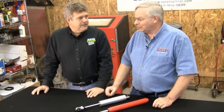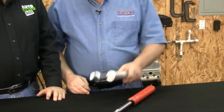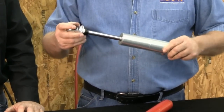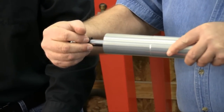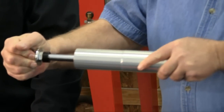Actually, so you can install it too. When you go to hook it in, you've got to be real quick when you cut that wire to catch it into the hole to get it to go in there. A hydraulic shock, on the other hand, there's no gas — it's not gas charged. The oil flows in between the upper and lower part of the rod all by itself through a little valve, and you can open and close it by your hand just like that.